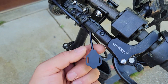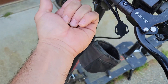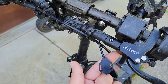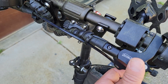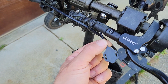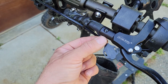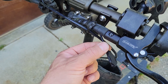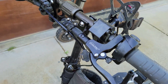I'm sure you can buy this cable for whatever scooter you have and go through the trouble of threading it through all the rigmarole required to replace it and put it back on, so your system will be complete. Nonetheless, this is the control you need to disassemble in order to disable your regenerative braking. At least now your scooter is safe and you can go home without having to worry about wrecking every time you pull the brakes. I hope this has been helpful. Thank you.